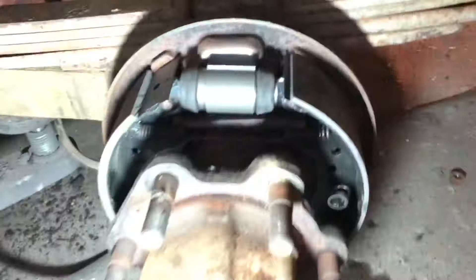The reason the rear brakes were seized was because of these wheel cylinders — the little pistons in here are absolutely solid. Can't move them, the same on both sides. So that's this side done, I'm just going to adjust it up, put the drum back on and move on to the front.